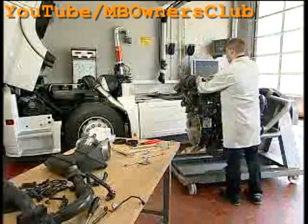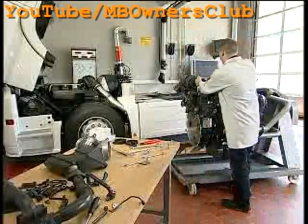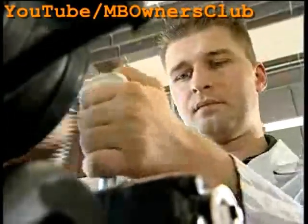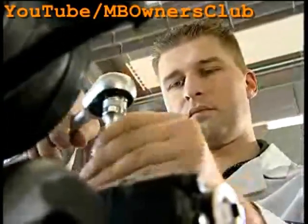Should you have a problem with the horizontal air compressor, carry out the analog assembly with the vertical air compressor. Now you've got two possibilities for the removal of the air compressors: either you remove both at the same time - though you should make absolutely certain you don't get the parts mixed up - or you remove one air compressor at a time. With the latter variation, you're more likely to keep everything in order. Therefore, our technician has opted for the second and more certain variation.